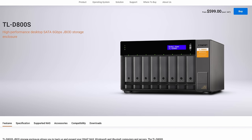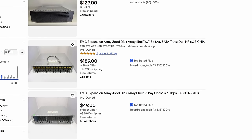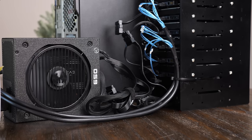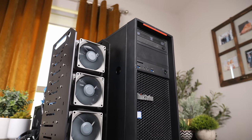One of the only units I found that seemed to support 10Gbps USB was one from QNAP, which costs over double what we spent on our DIY JBOD. Speaking of QNAP, they also make a JBOD enclosure that uses MiniSAS connections and a PCIe card rather than USB — once again much cleaner, more compact, quieter, easier to service, and without any bandwidth or connectivity issues, but it costs almost three times what we spent on our DIY unit. You can also look into used enterprise disk shelves that would have been used in server racks, though space requirements and noise are factors to consider, and you'll still have to pay for an HBA and cables. Obviously our DIY solution is a bit messy, not very compact, and just a bit janky — but it works, and with this setup you're not going to have to deal with the bandwidth limitations or dropout concerns of cheaper USB enclosures, and it's a lot cheaper than more sophisticated options.